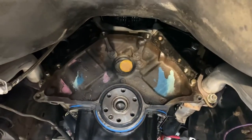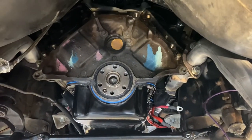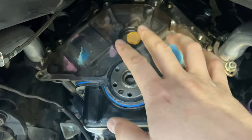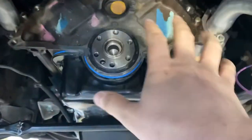I'm going to have to go and cut my floor, and I need to decide when I'm going to do that because I don't want to throw a bunch of debris onto my brand new fresh clutch and flywheel. So maybe I'll do that first, which will mean I'll pull the lift down. But one way or the other, I'll have to do one of those things first, just so we have adequate space to get the transmission up in there without contaminating everything - but you will see me come and clean all that.